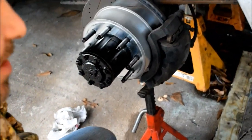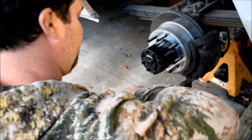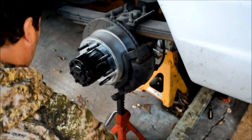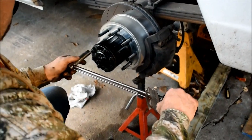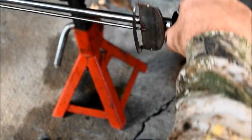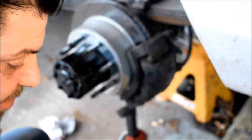Okay, between 60 and 80 was our torque specs on these bolts. Like I said, they're shorter than yours. So I just tighten them down with the old Milwaukee on number one and let them click a few times. So let's see what we really have. Oh, hell, that's tight enough. Anyway, 50 wasn't moving.